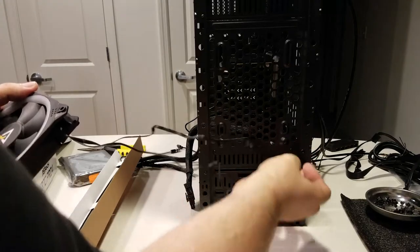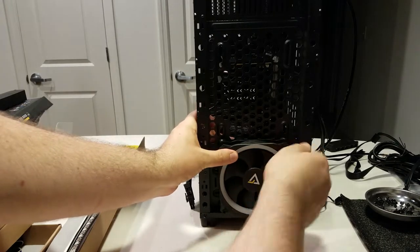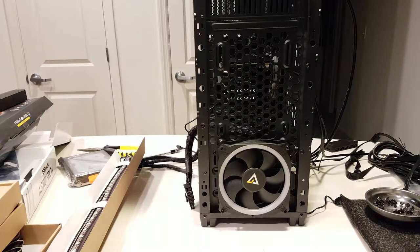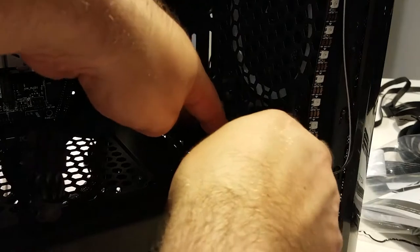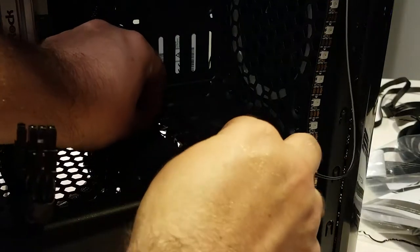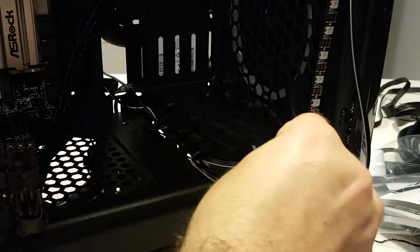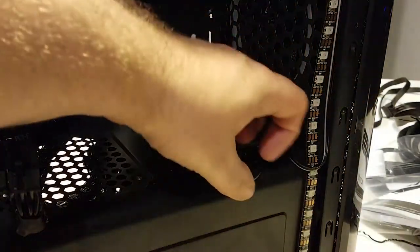What is not going to vary is we want to train our wires through the cable management hole we'll be using on the case before we mount the fan. When dealing with RGB fans, and I've only seen one exception, you'll be dealing with a lot of extra wires. We're handling this here by creatively using these cooling vents for hard drives by routing the ARGB connectors and PWM connectors through it. When installing a fan controller like this, you will always want to position it so all the wires take the most direct route to it, and of course so all the wires can reach it, to make everything look as clean as possible.